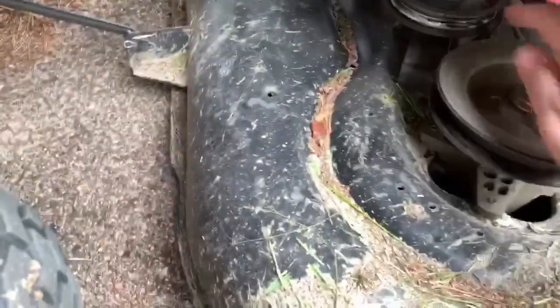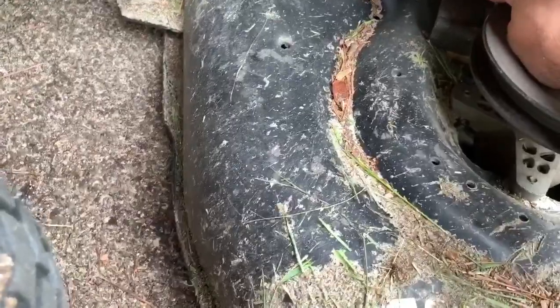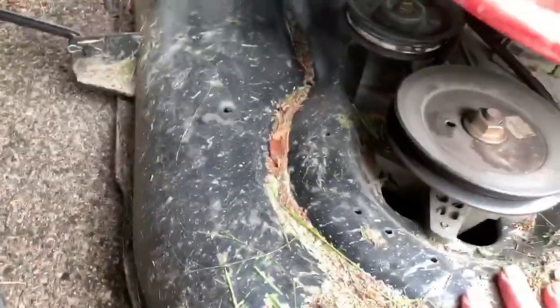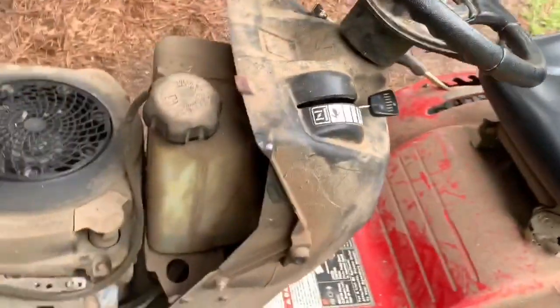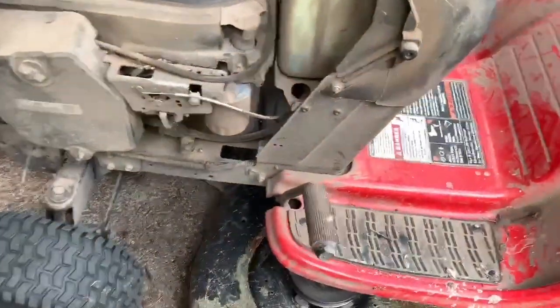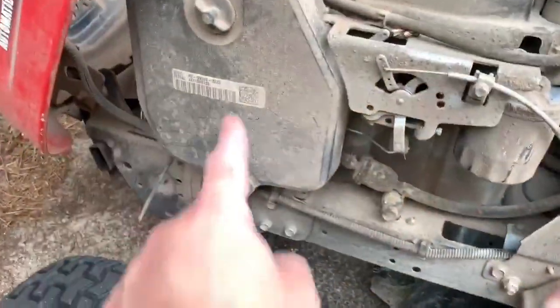You see right there — that is open. I don't know if you can see that, but you see that middle groove? It'll put a groove in them and wear them completely out. This lawnmower's got an oil filter on it so you can change your oil, and that's how you change your air filter.